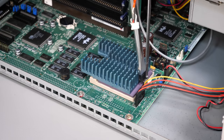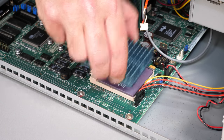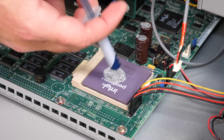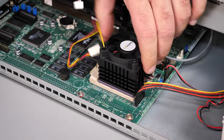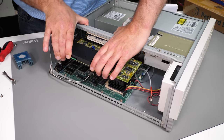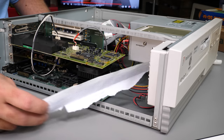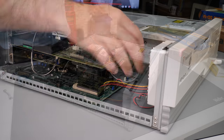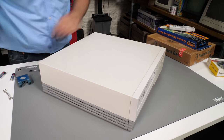Let's get that fan installed — that's certainly going to please some of you who noticed the old heatsink is not quite flush on the CPU. There's a lip; it's not quite in the CPU groove and some of you spotted that in the last episode. I'll add a bit of extra thermal paste to get more contact between the heatsink and the CPU but not too much. When I put the sound and modem card back in I noticed the clearance above the fan is quite tight. It should be fine because there's a front fan on the case drawing air in and pushing it away from the top of the CPU fan, then feeding out to the PSU fan and out the back.